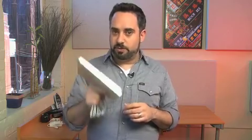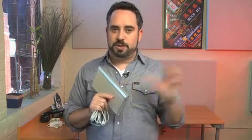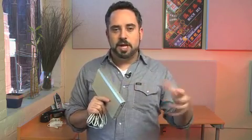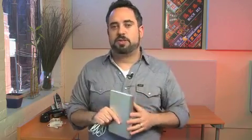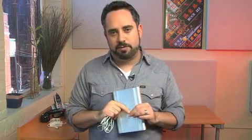One note about using this with MacBook Pros: as far as I know, this is the only external battery that does dual voltage for the laptop. MacBook Pros use 16.5 volts for normal operations, but when doing something really processor intensive, they cycle up to 18.5 volts for a little extra juice. This battery supports that, so make sure if you're looking at other external power solutions that they also do dual voltage, otherwise you're not getting the best performance out of your laptop.